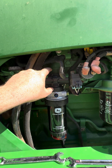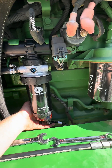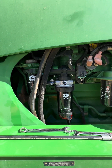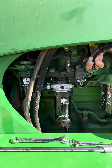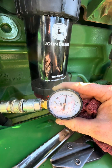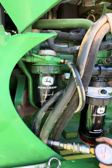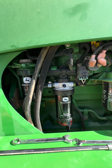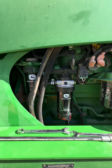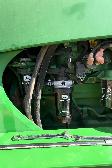So I ordered a transfer pump. You can get just the pump portion, but it was literally about $10 difference between the pump section and the whole assembly, which comes with a new water and fuel separator sensor as well. So I went ahead and got the whole assembly — that way I don't have to assemble anything. Got it on there, retested, and had plenty of pressure — about seven pounds the whole time. Underneath load it doesn't drop below five. So that was obviously the issue: low flow to the high pressure pump. The high pressure pump was outperforming what it had available, and the suction area would just pull a vacuum.